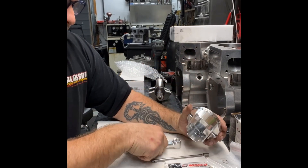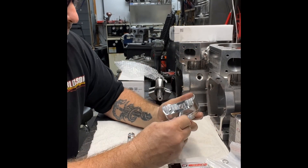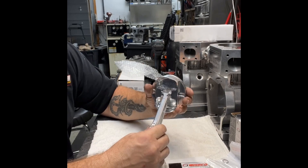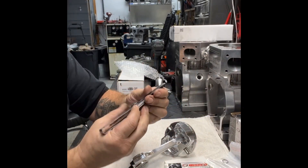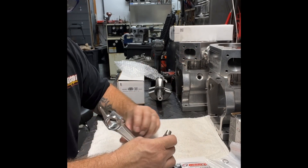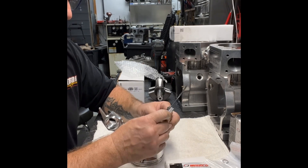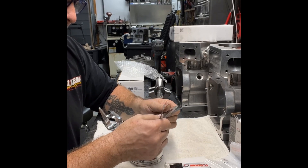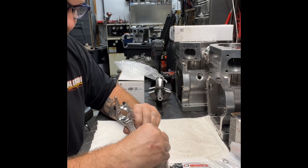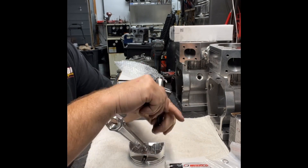This rod we know is clearanced — there's no binding, it's not touching. You can also put that together, grab your feeler gauge, come in and slide it down in between the piston and the end of your rod. As you can see, it goes through there no problem — that's a 4 thousandths. Let's try 8 thousandths — 8 thousandths slides under as well. So this one's got good clearance on it. We'll call this piston good.